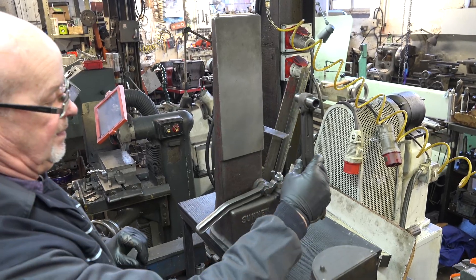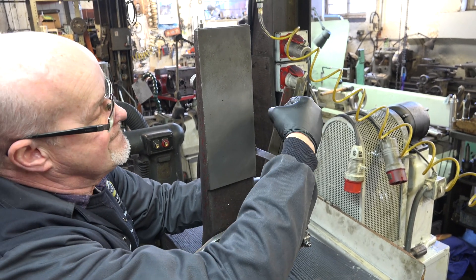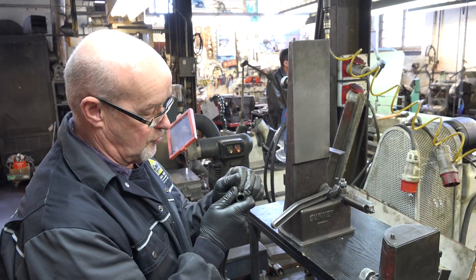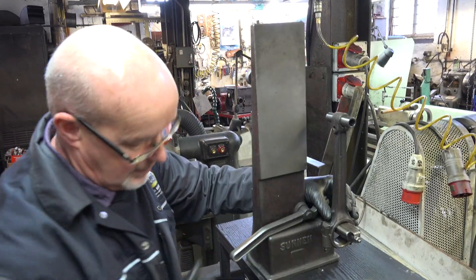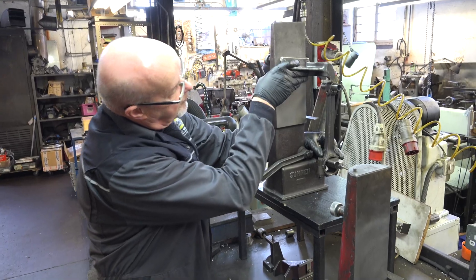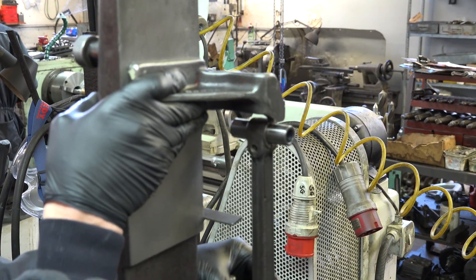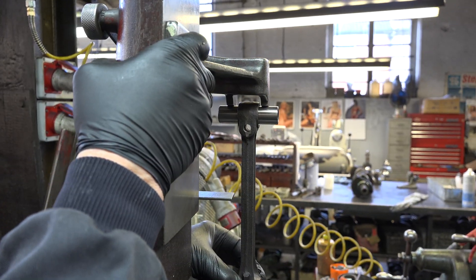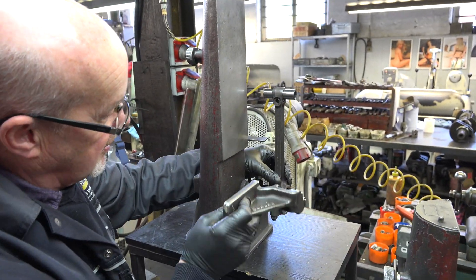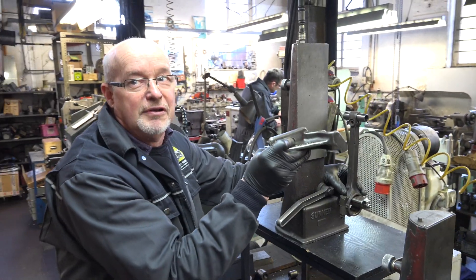The big mandrel goes on there with the caps on. This machine is absolutely square. If it's loose it can flop around and give a wrong reading. This is dead square. I'm going to put this above the rod, set the rod roughly central, and now I'm looking for light on either side. Looking in — you can see no daylight between: perfectly aligned. Then you turn it around and do it again. If you get a slight bit of light one side and then you turn it round and the light is on the same side, you know it's not the rod that's bent.